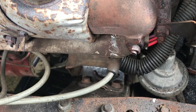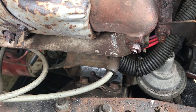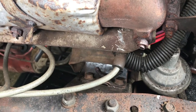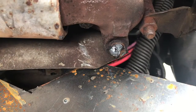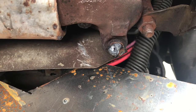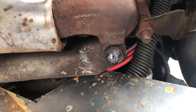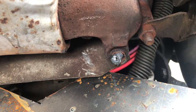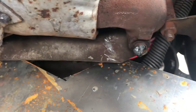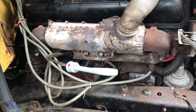The fittings are ready to weld. I did a little wire wheel on them — they are very rusty and thin. Some people just pinch them off and leave them a bit long, but they're pretty thin. I covered the spark plug wires with a little bit of sheet metal. Grounding wasn't great but it got the job done — not pretty, but okay.